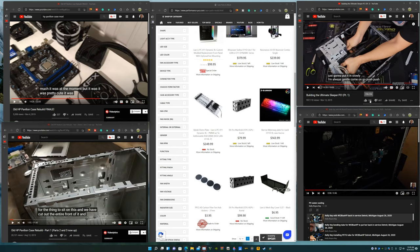But some of the obstacles with that is what Kyle is going to start seeing: where it's pulling air from is up here at the top. And with putting the fans up there, which is the reason why I water cooled mine, you're not starving. Because even if you put a fan on the front, it's trying to pull air from up here. And then you also have the problem with your graphics card competing with your power supply. So pretty much this is just some brainstorming and some of the things that I was looking at.